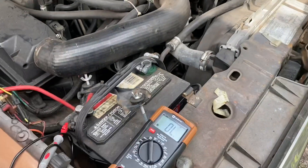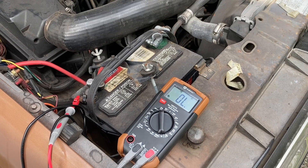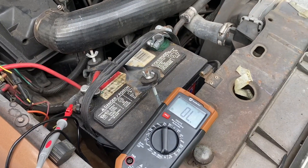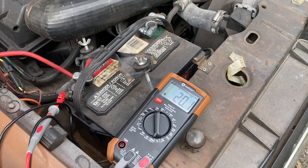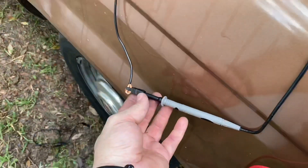Now that you know what your code is, it'll repeat twice. Then you'll hear that tone — that's telling you it's going to start over: three... one. Now you can disconnect your negative and it'll just continue to repeat that same loop.